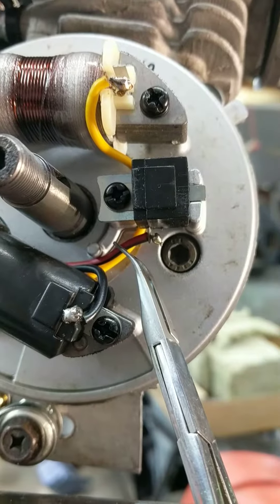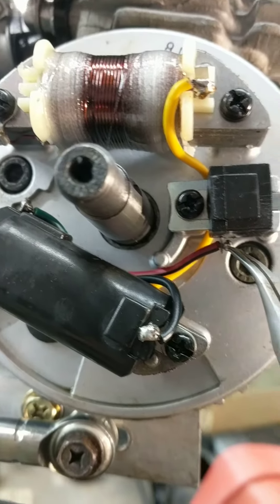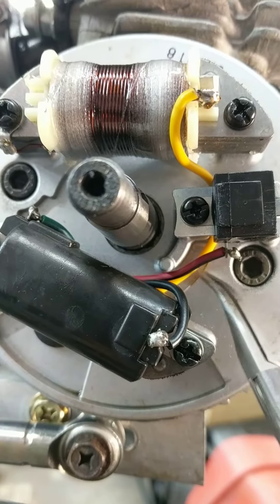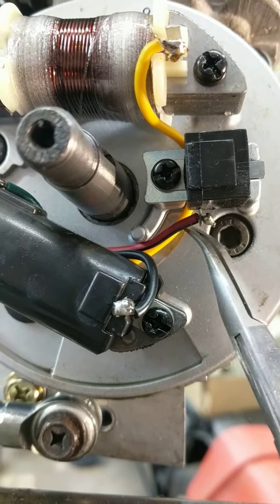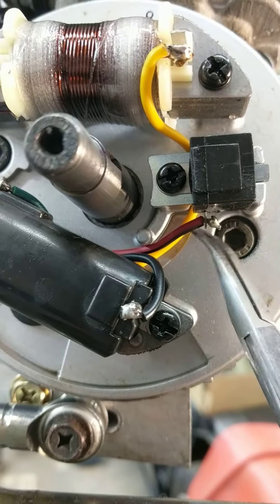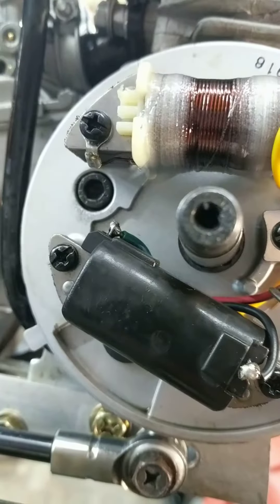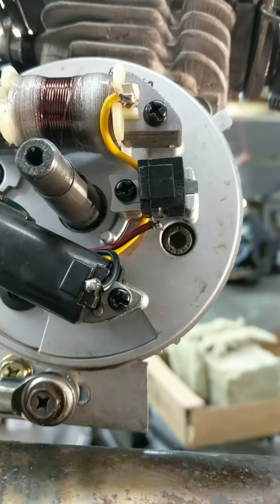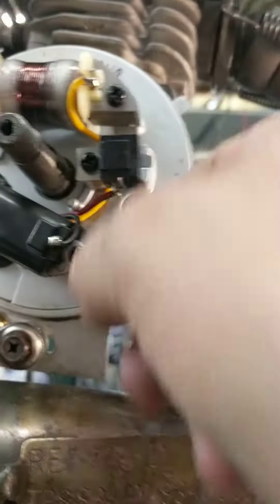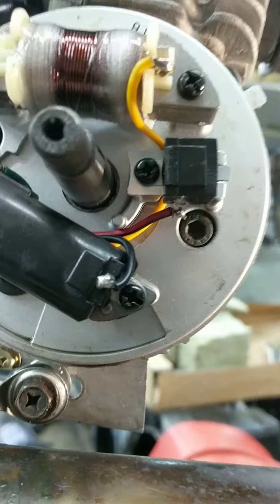Until I got down here and found this little red wire — it's completely loose, not soldered in at all. I'm thinking this might be my issue, where it would work and then not work intermittently. We're gonna find out. I'm not sure if it was mentioned on the forums — Moped Army or whatnot — but just keep that in mind.